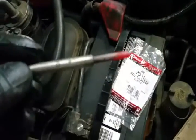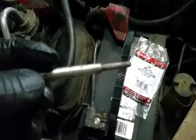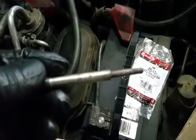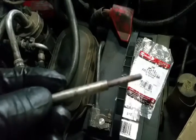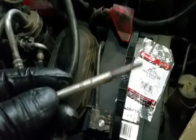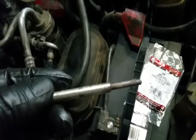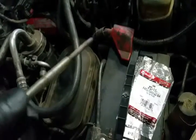Some of the major issues with non-OEM glow plugs is that the tip can swell up and get stuck in the head, possibly needing the head removed. In the case of these 7.3s, they just gave up. I had put some AutoLite glow plugs into one of my 7.3s, and after a year there were only about two working — there were like three swelled tips, a few dead shorts, a few others that were just dead, and I ended up burning up a wire harness underneath one of the valve covers.